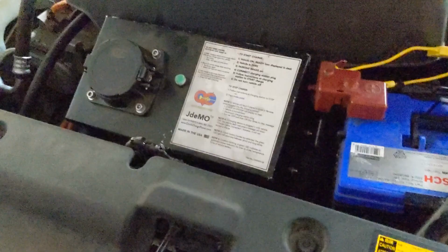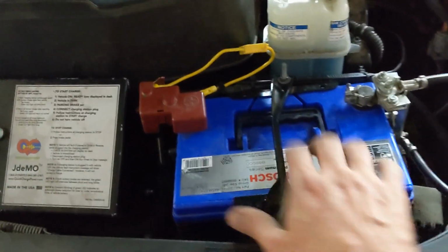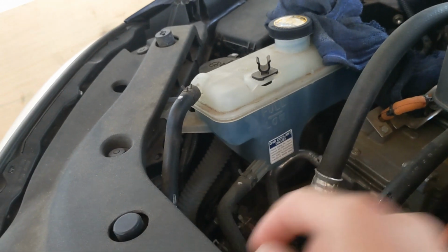Enough damage. Alright. Next I bolted back this part over here, 5 bolts. Put the battery back. Bolt there, bolt there, bolt there, bolt there. Next we put back the service plug grip. Now I have to bolt it up. Next we put coolant in all the way to the full level.